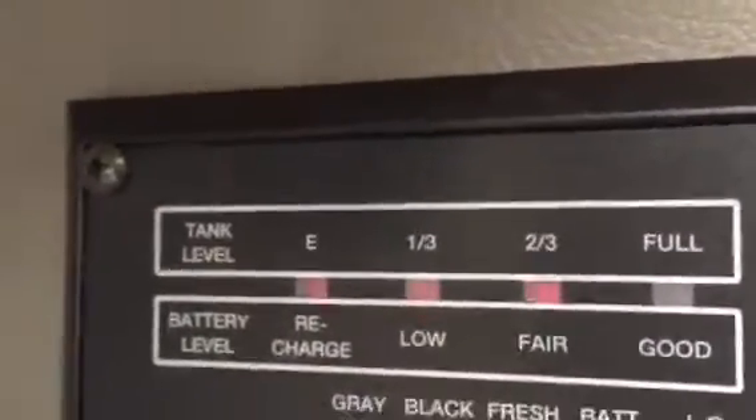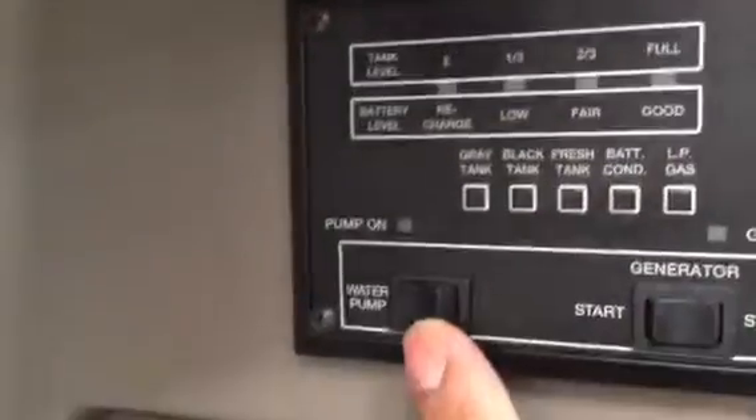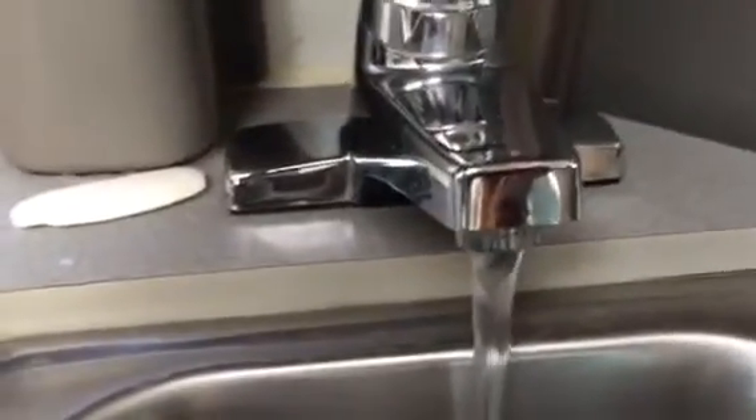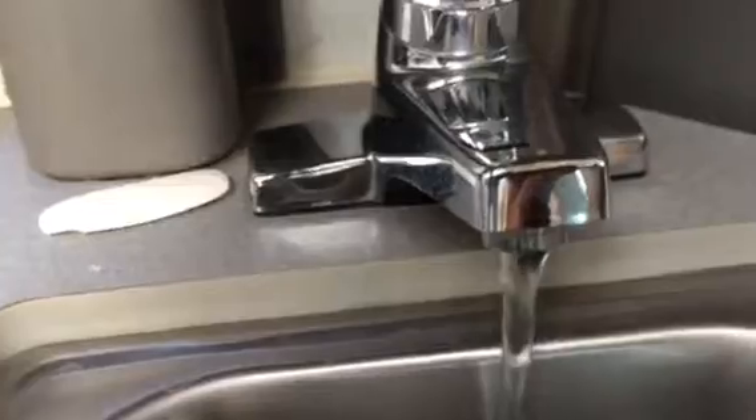Let's plug it in now. Look at the detector here — no light. So we have no power. Now I'm going to press the battery indicator — the lights are very dim but they say I've got three-quarters of a battery charge. I'm gonna turn on the water pump. We got a light but I don't hear anything. Run the water and — the pump kicked in. Good. So that means I now have power over here. Look — we can go to our LP detector and we have a green light.